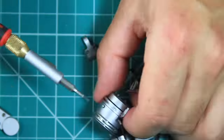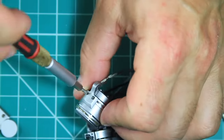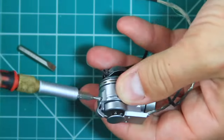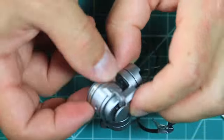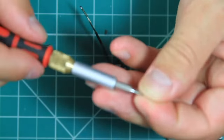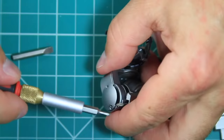At this point, it's just a matter of replacing the existing cables with the new ones and putting the covers back on. This will also be in the real-time version that is linked to. The biggest thing to be careful of is making sure that nothing is pinched and the gimbal can freely move in all its degrees of motion.